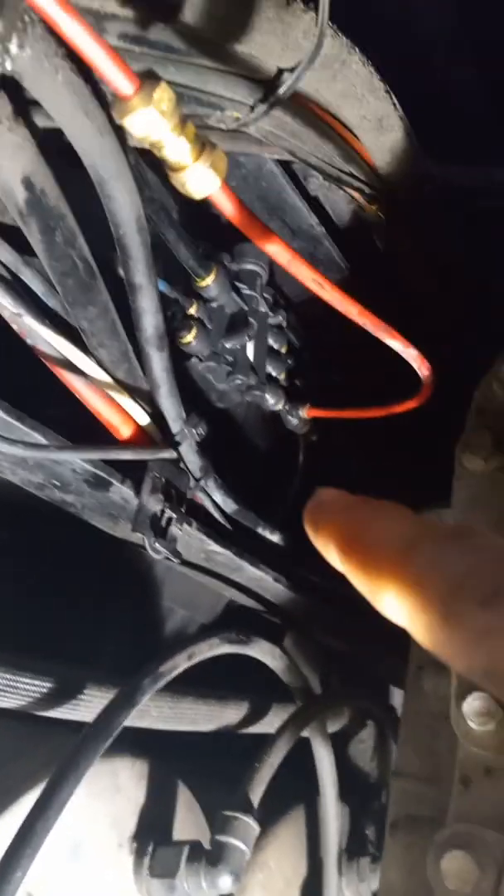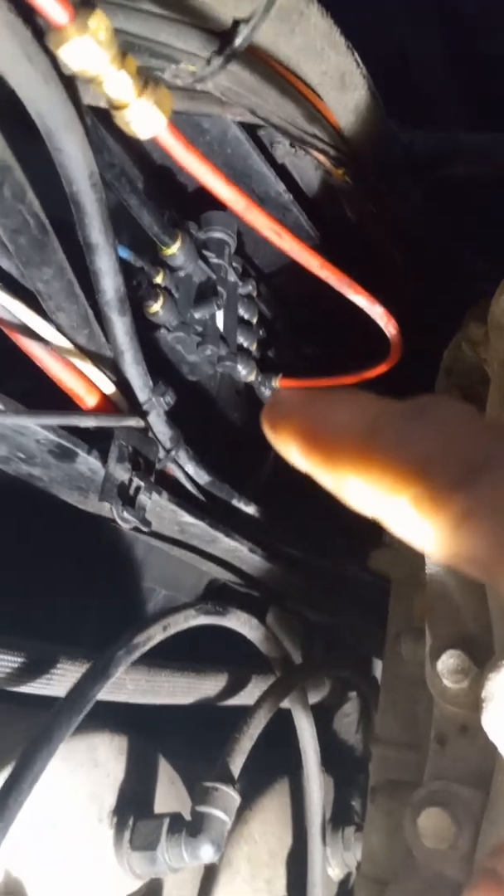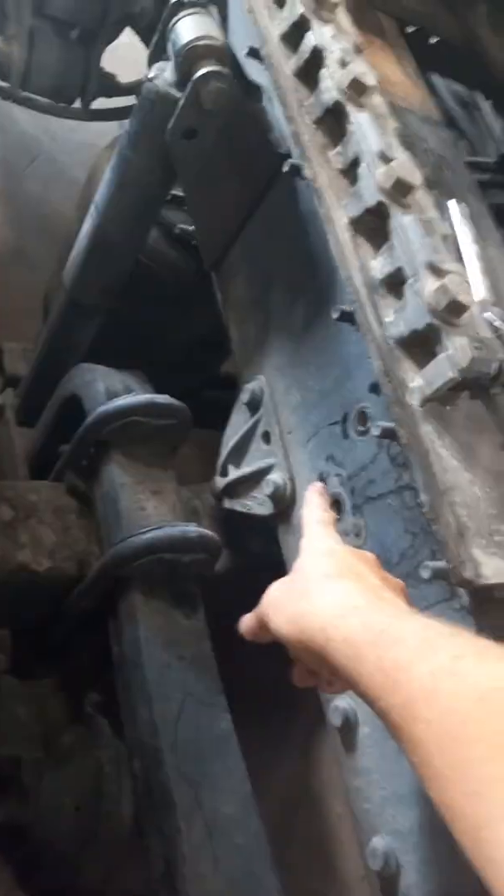Already got the light in position — there's the air manifold mounted on the driver's side frame rail. It does have a bolt at the bottom for the bracket. Pop the lines off; it's an 18-millimeter head on the outside of the frame and a 21-millimeter or 7/8 wrench. Pretty much the same thing for the bracket on the actuator — there are actually two bolts that hold that on.